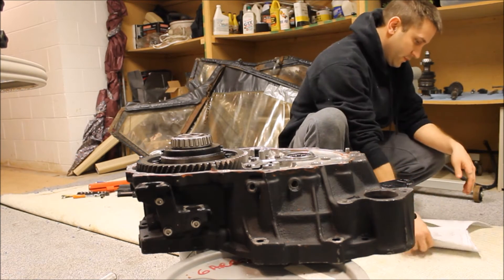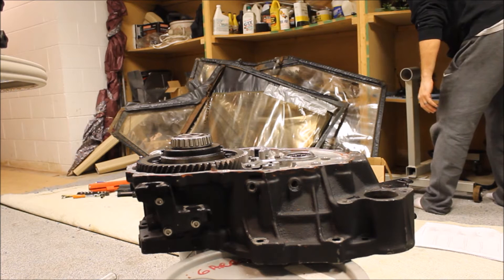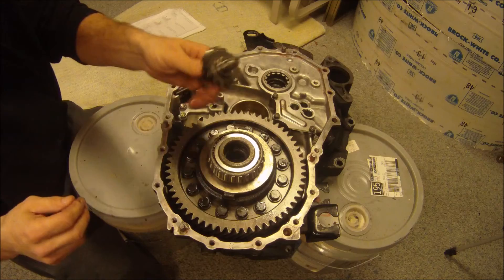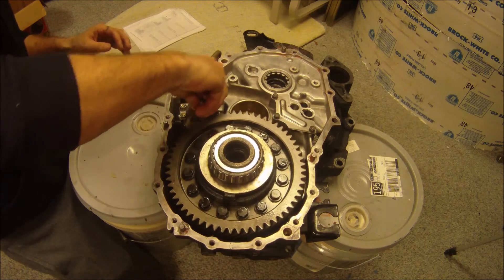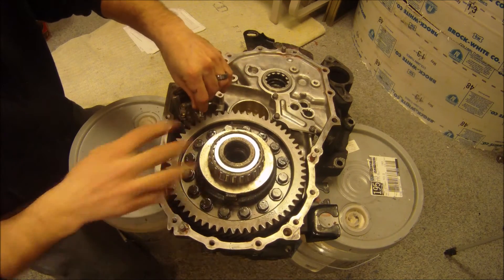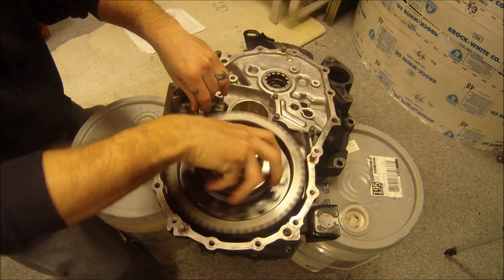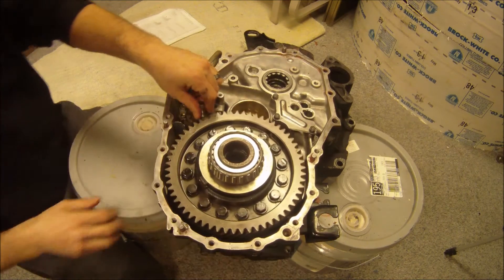Install oil pump drive gear. There it is. Obviously if you change to the 393 gear ratio, you need a different pump gear to mesh. But you just jiggle it around until it goes in — and that's it. There's a spot in the case that holds it, and this is what drives the oil pump. So essentially the faster you go, the faster the pump spins going down the road, because it's just run off the diff. So when you're stopped, the pump does nothing; the faster you go, it pumps more.